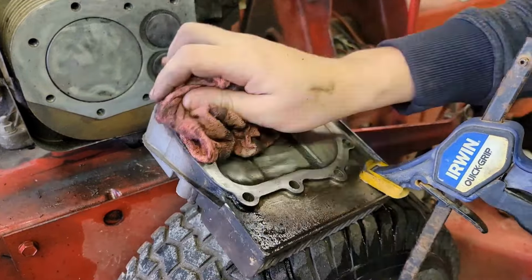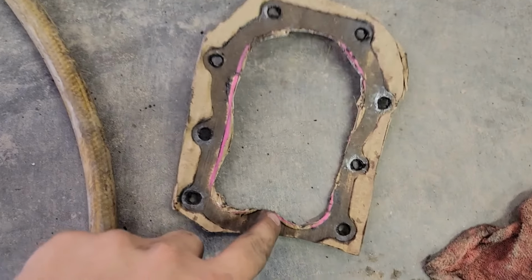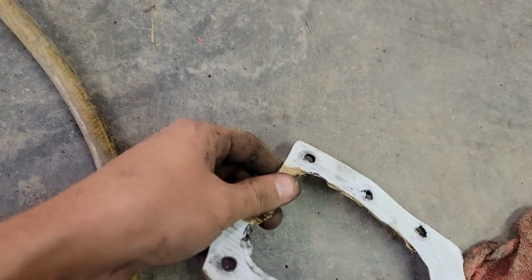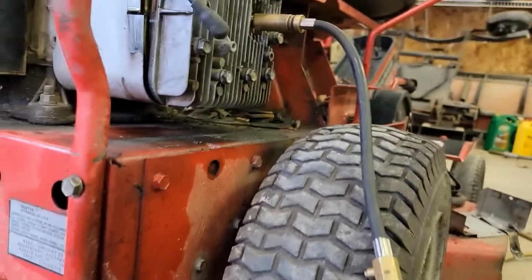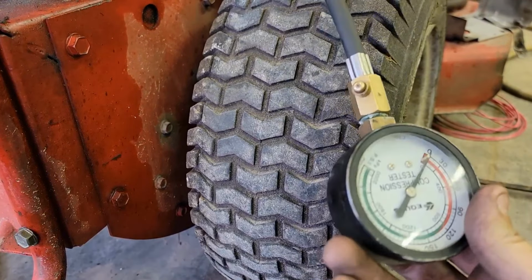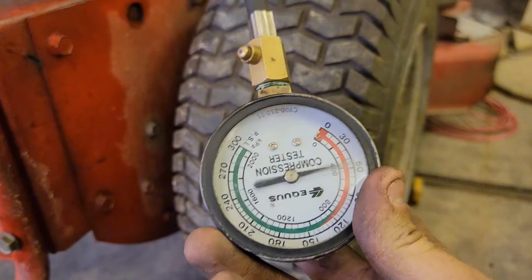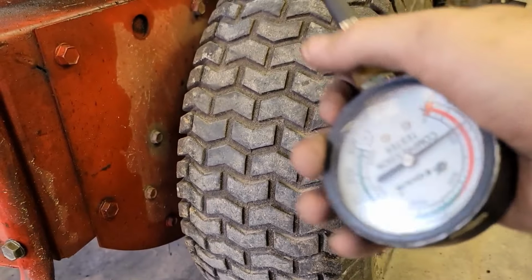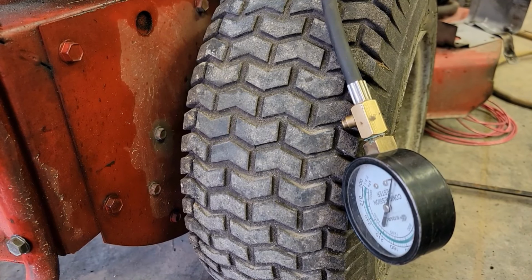Okay, so the one I just made, it had too much cardboard on the inside around the valves, so it actually got pulled under the valves, and basically there was no compression. So I just went and took the one from, I have another one with basically the same engine. So here we're seeing how much compression it gets. Originally it had like 40. It's definitely better. And then I'll show you that it does have spark.